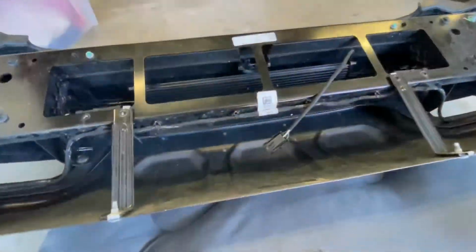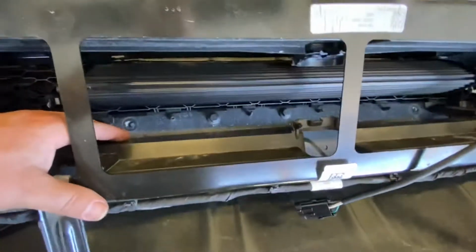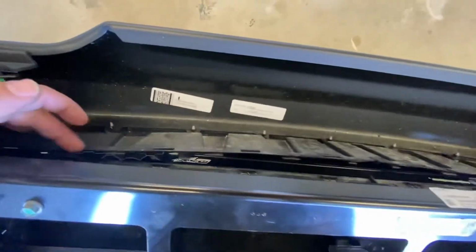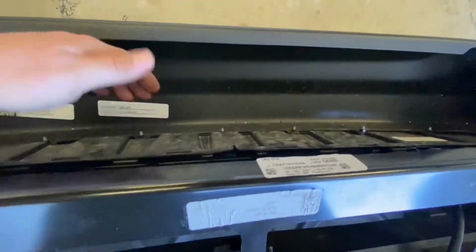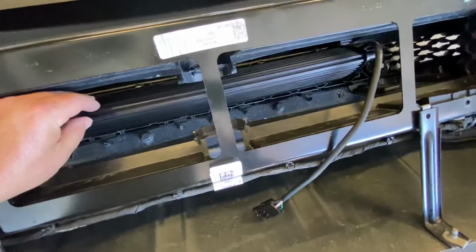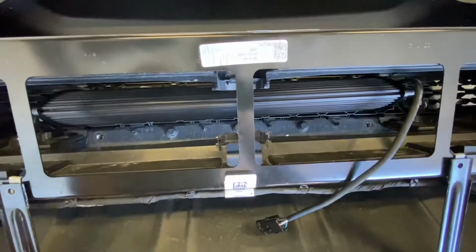Okay, so next update, going in from the bottom, there's just not enough play in this plastic bracket right here. So actually what I was able to do is undo the clips along the top of the shroud. This guy came out, and with a little bit of help, just folded in enough to get the light bar through here and up around, so it kind of sits in here right now. That leaves us these screw holes ready to put our brackets on.